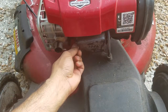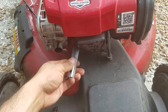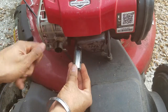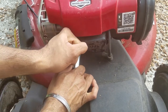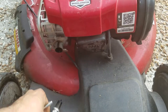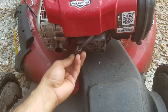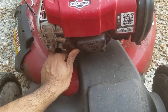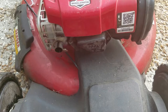Initially feed it in by hand. Again, remember it is a little bit angled. Tighten it with your socket tool — push it in and just give it a little bit of a tug, but don't break it because it's very delicate. Dispose of the old spark plug carefully, push the wire back in, and you will hear the click. And that's how you replace the blade, air filter, and spark plug on your lawnmower.